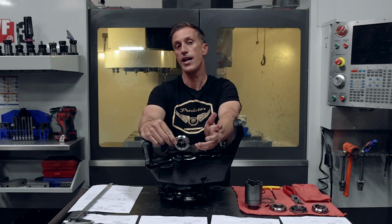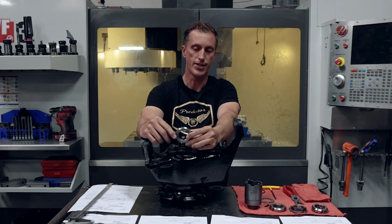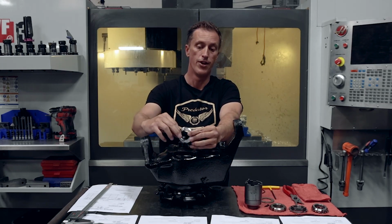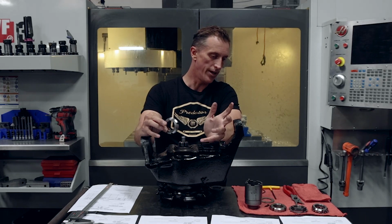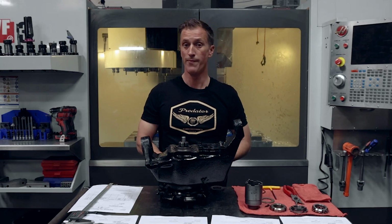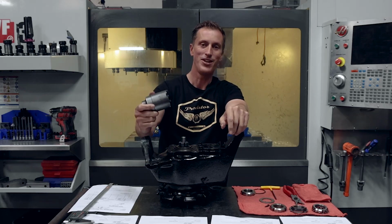They cost about 80 bucks per corner, so a lot less than $125 per corner. And that's with the washer as well as the set screw. And that one gives you a full 360-degree lock on it, really pinches off on the entire threads. There's also more threads on here. There's 9 threads versus the aftermarket one at I think about 7 threads. So you get a lot of bite on that shaft. You're also testing it at 90 foot-pounds of torque, trying to remove it. It's not going anywhere. That, in my opinion, is the best one out there. Disadvantage is everything comes with a price, right? You have to use a specialized tool.